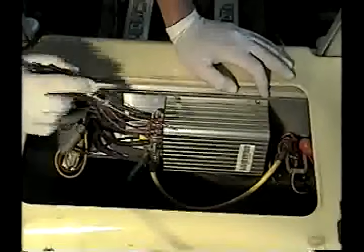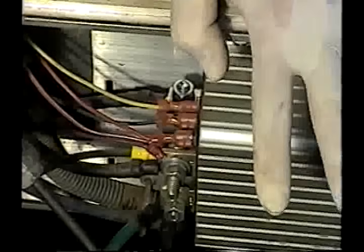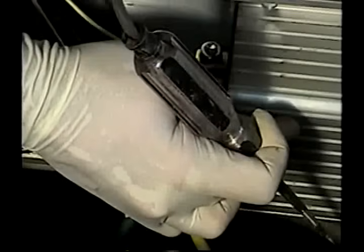Now we're going to talk about how to test if the controller is bad. This controller is made by Curtis — it's fairly standard for any golf cart with a solid-state controller. One of the first things you check: of these three spade terminals here, this is a low-amp circuit. The red wire is what feeds positive current into the controller. So the first thing you want to test is clip your probe light on the battery last negative, probe this spade terminal right here — make sure you don't touch the case — activate the system with the foot feed, and you should see a light. That's telling us we got current into the low-amp side of the controller.